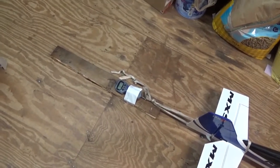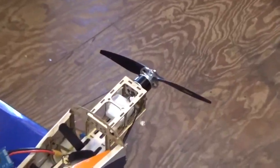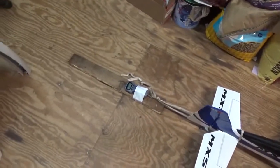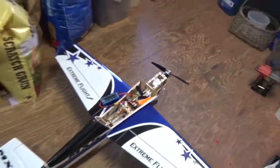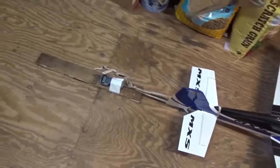We gained about 10 ounces more thrust with this motor, and the amps were just about the same. That's kind of why I like this for 4-cell. I'm definitely liking this 750kV motor better for the 4-cell guys. Interesting tests — very good.